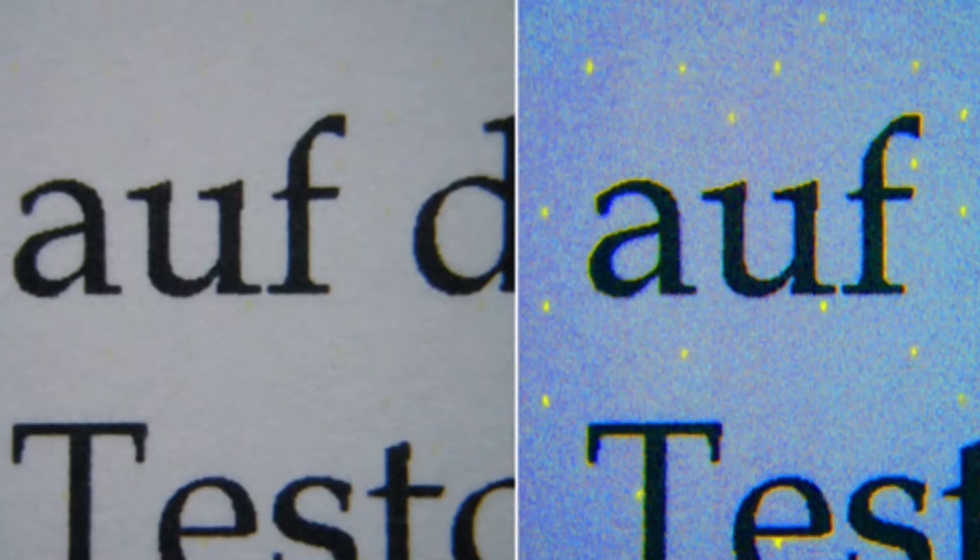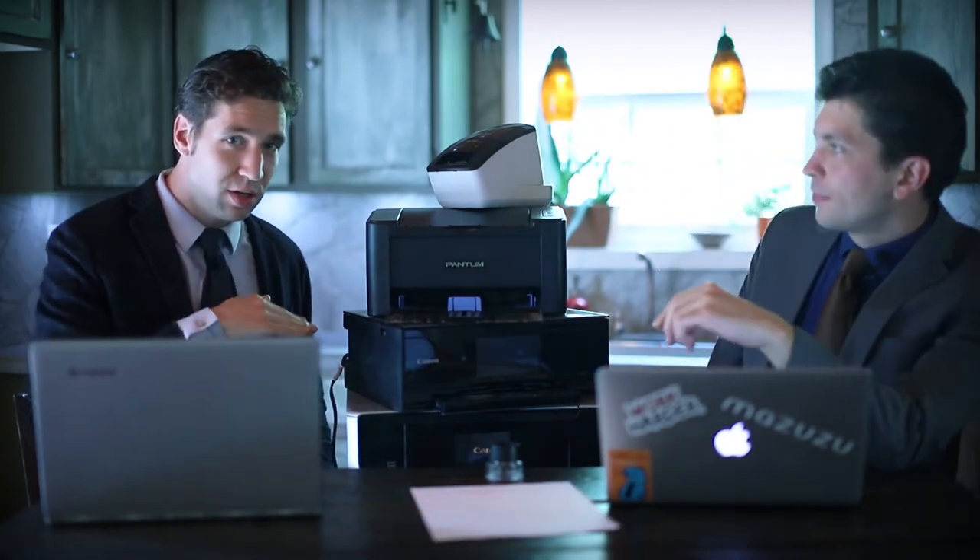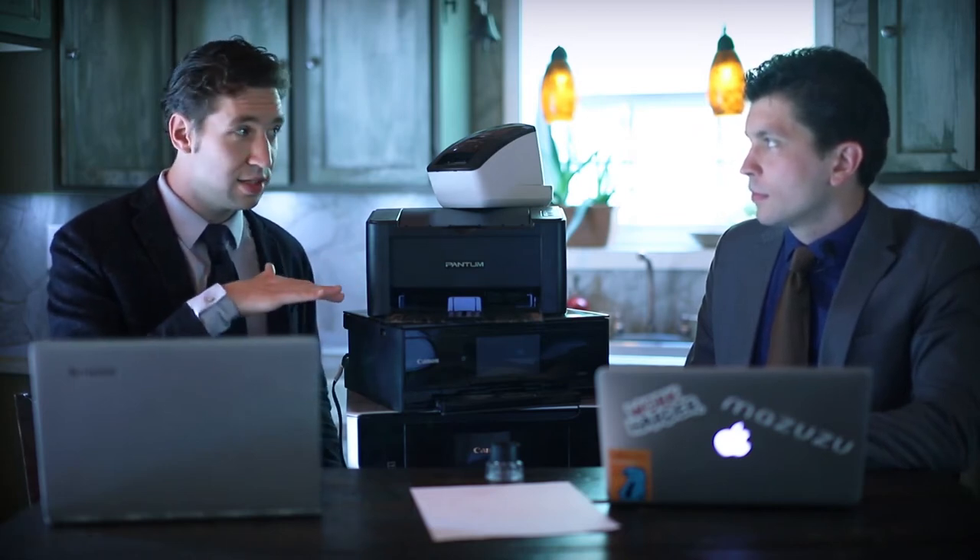This is basically a fingerprint. Why would you want to print dots? Well, we want to trace things back to where they were printed. So this is a fingerprint that gets printed on most sheets of paper — pretty much everything you print. You've seen it many times and you've never noticed it. You can't really see it with the naked eye because it's tiny — 0.1 millimeters. They're very small and they're yellow, so they're very hard to pick up. They're in a pattern that denotes the serial number of the printer, the time and date that the document was printed.